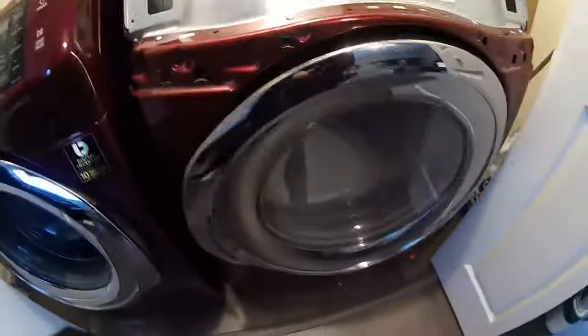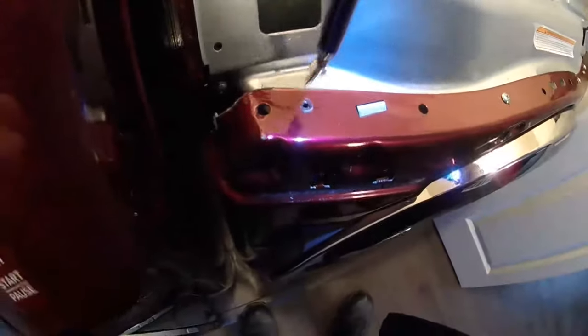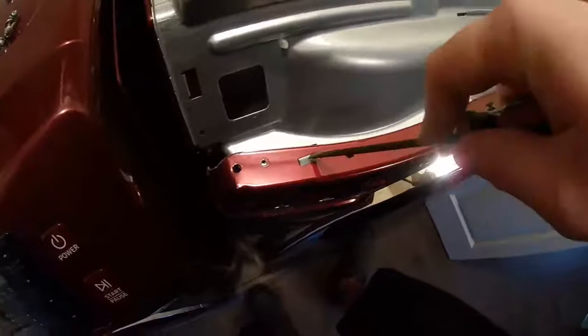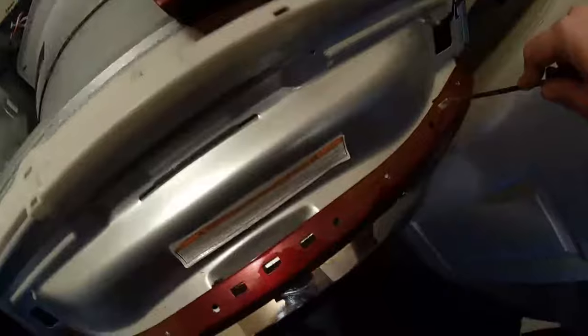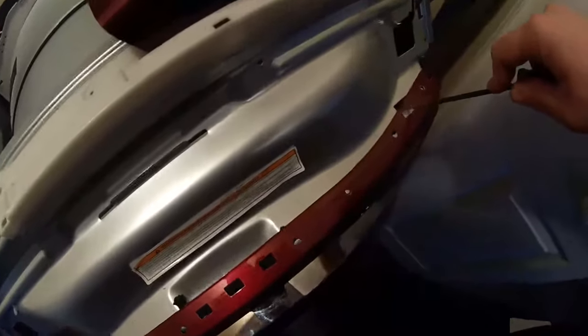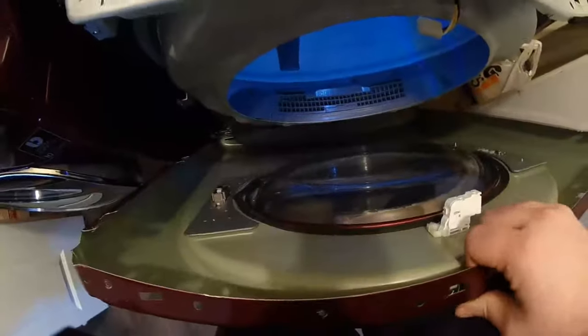Now we've got a total of four screws up top of the front panel, so go ahead and take those out. We've got one and two locking tabs to hold this front panel on, so all we're going to do is just kind of push those down to disengage them. As you can see, the front panel just kind of falls off, so be ready to catch it once you push these down. Pull this back away, disconnect the door switch, and this has tabs at the bottom that hold it in, so just pick it up and move it to the side.